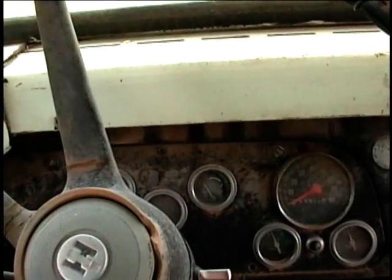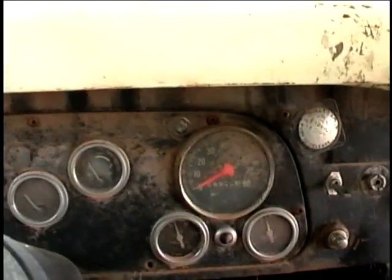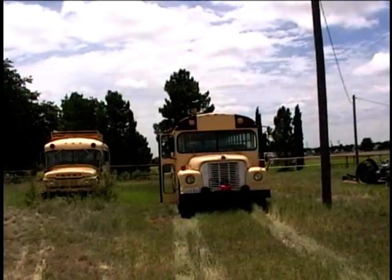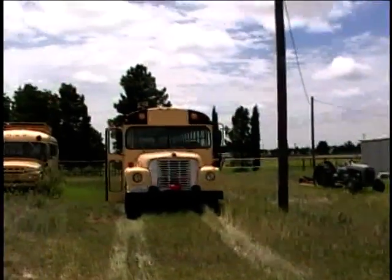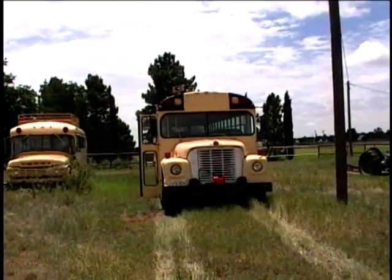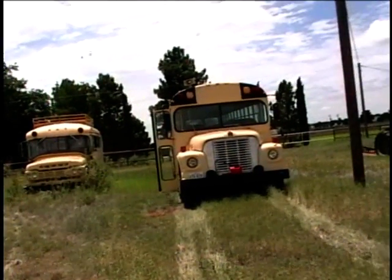It's running about as smooth as it ever did, which isn't great, but I think I may change the oil on this. I'll go ahead and apply the air brakes. Didn't get it quite lined up perfect, but not too bad. I might try to get it closer to the '59 Ford, but I don't know if I can get another one in there. Next I'll try to drive it a lot more now that I've got the carburetor clean with Berryman's B12, because before it wouldn't even idle — you'd have to keep one foot on the brake and the other on the gas to keep it running.